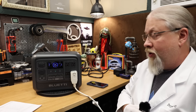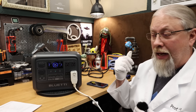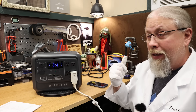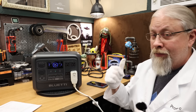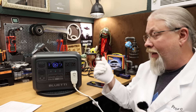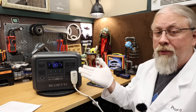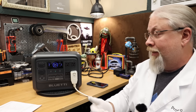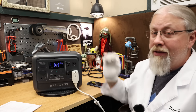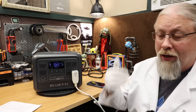This will not run a window air conditioner. The unit I have is mechanical, 5000 BTUs — you won't find anything smaller that pulls less watts. It normally runs about 300 watts when the compressor kicks on, but it was pulling 1200 to 1300 watts with the compressor not running properly, which would quickly destroy the air conditioner. I ran this test three times total, and it's a fail.